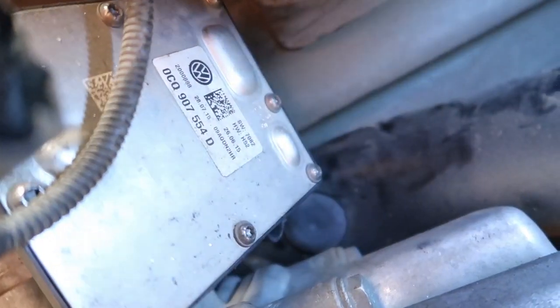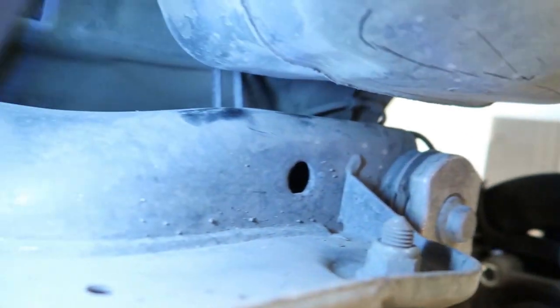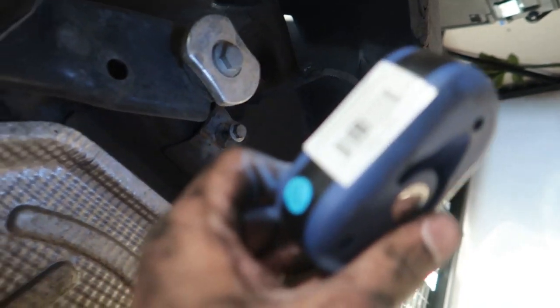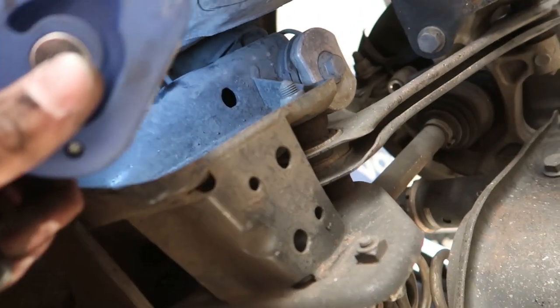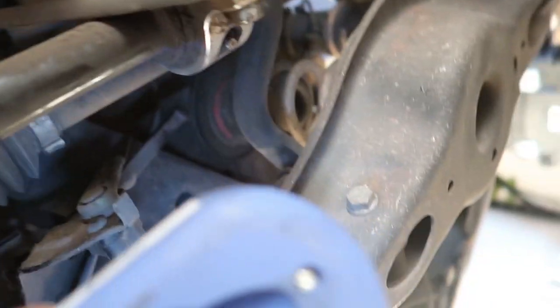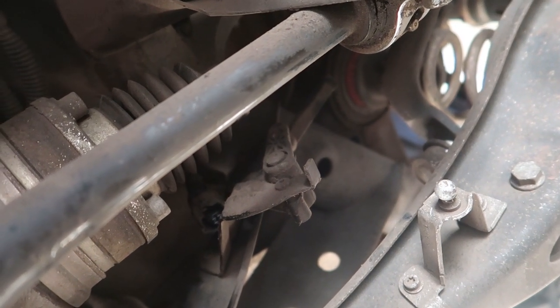Alright, driveshaft is off and kind of hanging there. I disconnected the level sensor that goes on this nub and there's an electrical connector for it on the Haldex box. There are two connectors on top of the unit - one is a big plug, very annoying to deal with. Brake lines run across the top and there are brackets holding them to the subframe on both sides. Those four bolts are the only things holding it in. As I lower it I'll have to deal with the brake lines, but the Verkline subframe comes with new brackets for that - it has provisions for everything. It's super dope. I can't wait to compare them side by side on the ground.